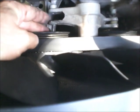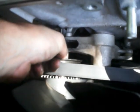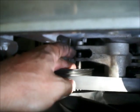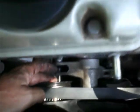It leaves a little scratch here as it pops out. I'm not satisfied with this — it's failing the design. That bolt is just too long. I will use a file and make it shorter so that when I put it back I don't scratch anything. I'll push the bolt to this position, get a file, and make it a little bit shorter — because it was really just one millimeter or so — and that will give me a chance to install the new shock without any scratching.